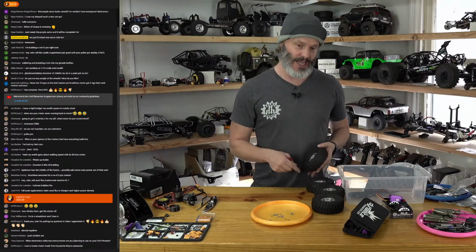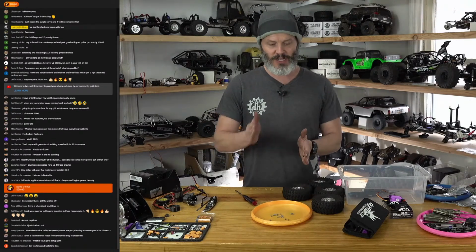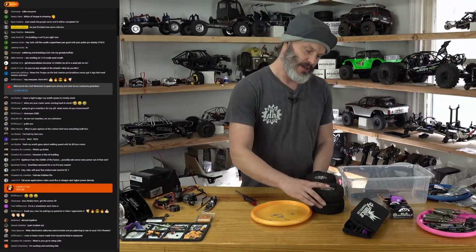However, there's the expense of making that particular motor, because you can't just have a single plane axial flux, where we would have, let's say, stator, magnets, and stator, or you can do it the other way where it's magnets, stator, magnets. We just choose the one that has stator on the end for this particular purpose. The length of one stack isn't going to get us very much. So to produce as much torque as we could in a 540 frame, essentially searching for proper flux gap area to compare them with, you need 3, 4, or 5 of those stacks, depending on how you configure it, to really start to compare to a normal 540, like a 4-pole, which is relatively optimized for the RPMs that we encounter in rock crawlers and most RC cars.